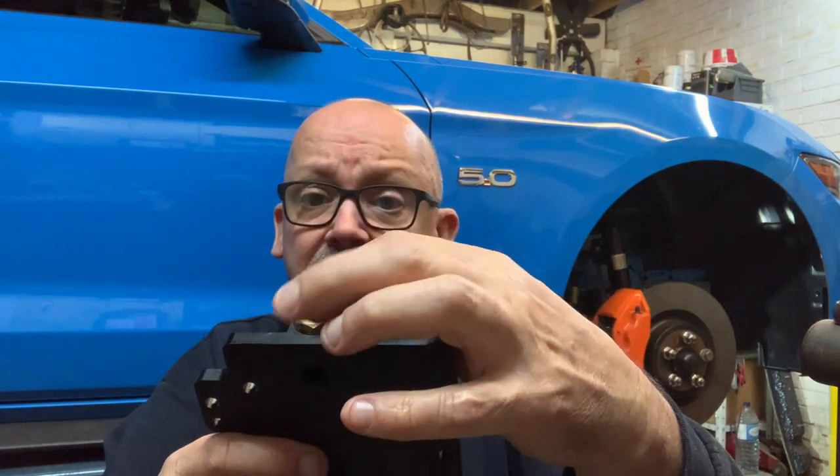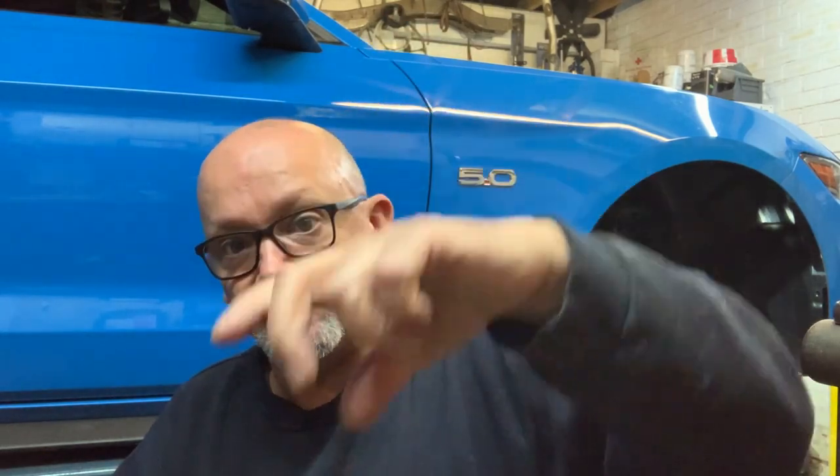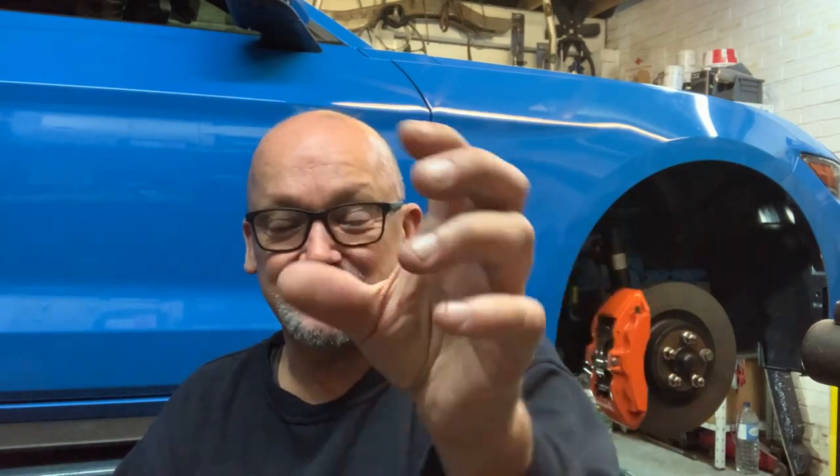And I'm going to put my oil temperature sender in there, from my cheap, nasty Amazon temperature gauge, which is not good. I did a test on it this morning: I got the kettle boiling, so obviously the water's 100 degrees. I put the sensor in there and the gauge went to about 85, but if you tip the gauge on its side it would go up to nearly 100. It's got a balance weight in it, so as you move the gauge around the temperature goes up or down. In its correct vertical position it's reading about 80 degrees when it should be 100. So I'll have it in the car tipped over 90 degrees clockwise, then it's correct. So there you go.